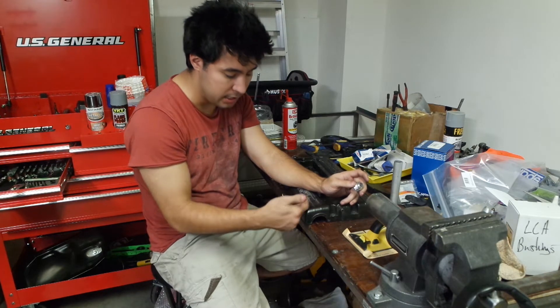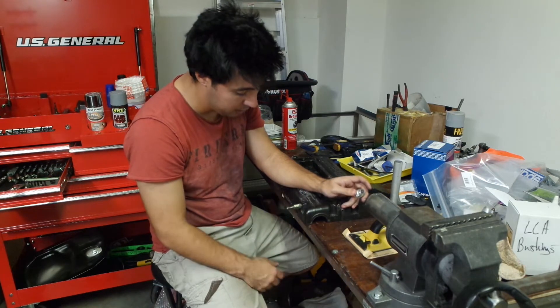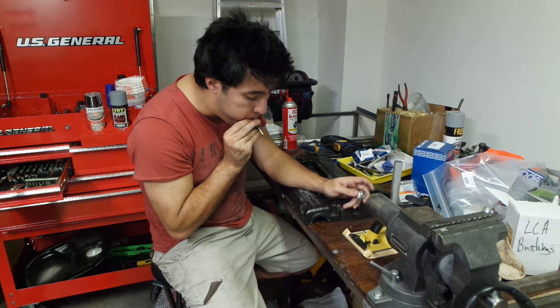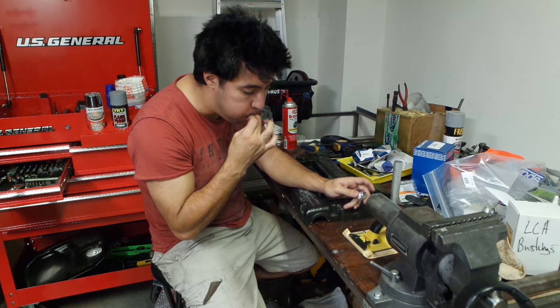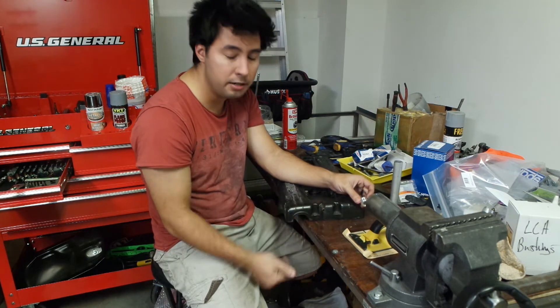With that check valve in there — it's just a sliding check valve, so it doesn't even have a spring in it; maybe it did at one time but it doesn't anymore. So we're going to remove this. I've already cracked it loose and nothing goes through. Now something goes through. I'm going to remove this piece here — if you just drill through here, you're going to get into your baffles.